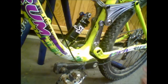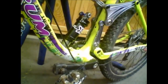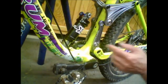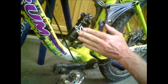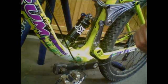At the same time, the wheel is free to respond to any vertical bump forces through the normal rocker. So we can see that the missing link and the rocker are continually combining their forces to modulate what happens to the shock — making it stiffer, softer, or leaving it alone depending on what you need as a rider.